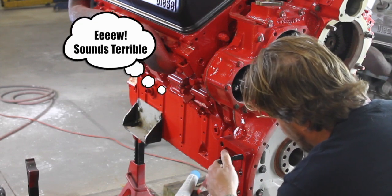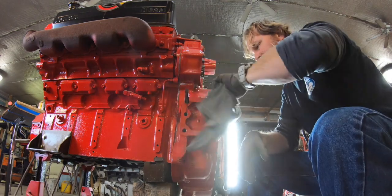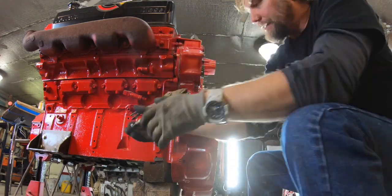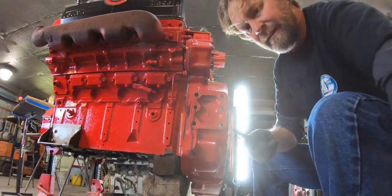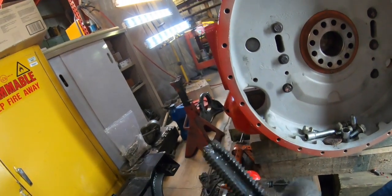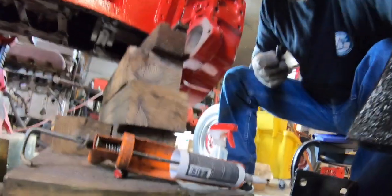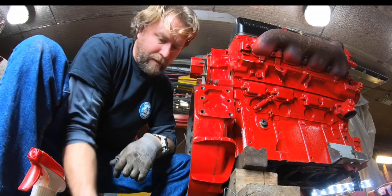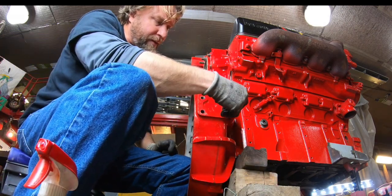There's a ton of corrosion there, I can see it on the tap. Hardest part about putting any tap in is always getting it started. That's when you're gonna screw things up. Yeah, so this one here had a lot of corrosion in it. So there's a little piece of aluminum or so in there too, and I don't know if it was binding up when I ran it. I'm gonna do this one more time. I think the other two are a lot cleaner.